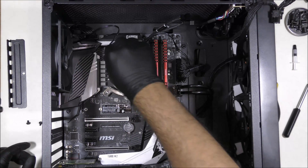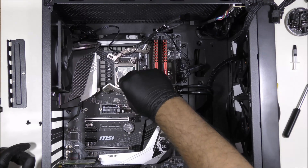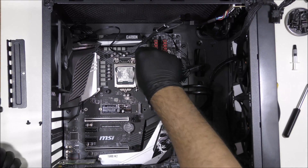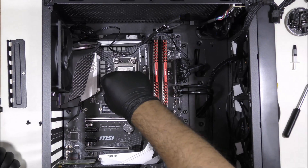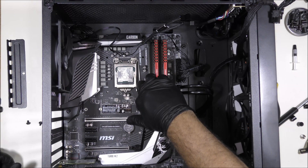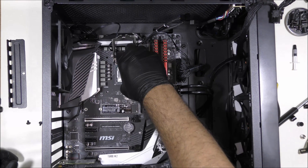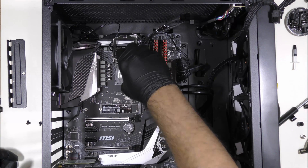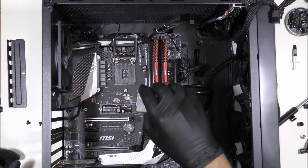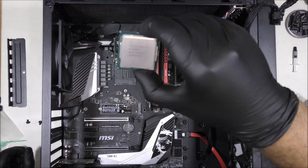The bracket might fall inside the computer from the back — that's okay. Let's remove the mounts and spacers from inside the computer because we're going to have to add new ones. We're going to release the CPU and get it cleaned off so we can insert new thermal paste. After getting the CPU cleaned, as you can see it's sparkling new.